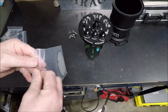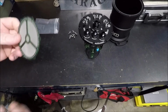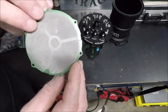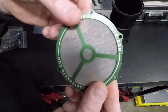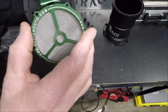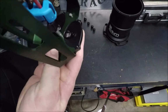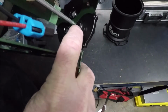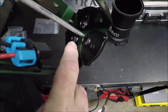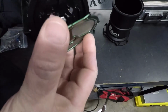Yet another cool feature of this surge tank is you will not be using the sock filters that come with your Walbro pumps. Instead, you have this micro screen, stainless steel screen here. After you put your pumps on, this screen will actually screw on here, and that's your strainer. I'm not sure if I can get it on camera, but the input from your pump is actually going to fit in these holes on each one of these.